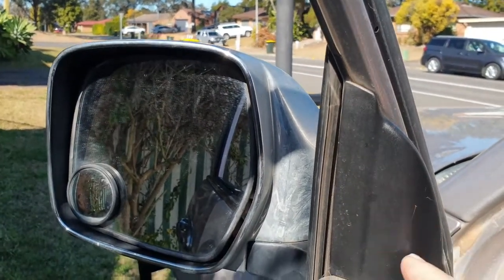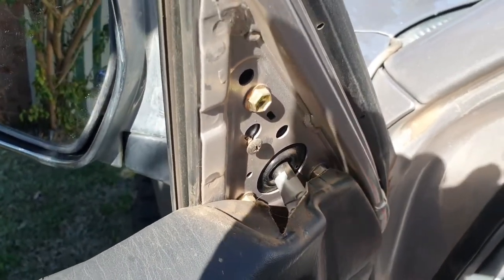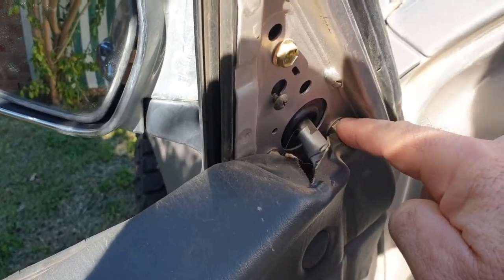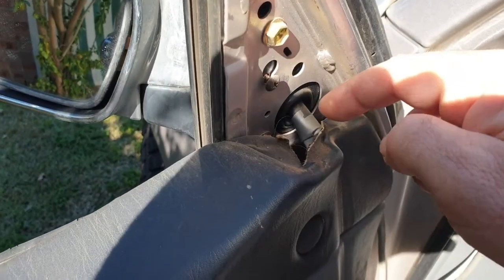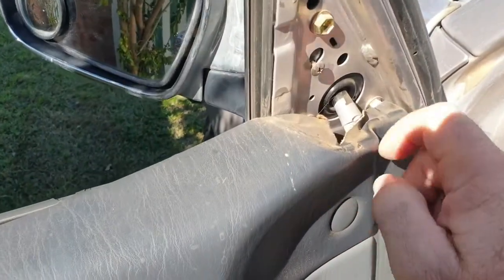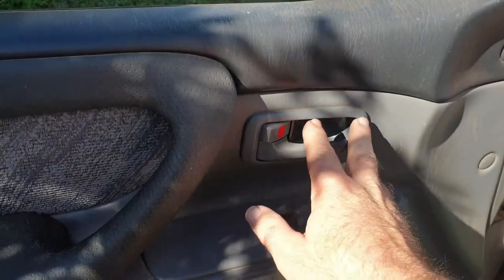So I suspect we're going to have things underneath here. Yep, there we are. You can see here we've got one, two, three nuts to take off. This one here is just to hold it in place while you get the nuts started so it doesn't fall down on you. But then you've got this one here which is your electrical, and that goes down in here. In order to get down to there we're going to have to take the whole door card off, so that means first thing up is taking this handle off.